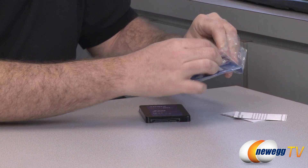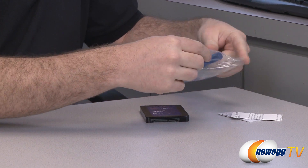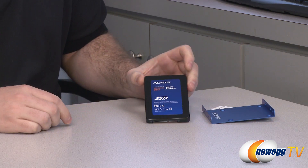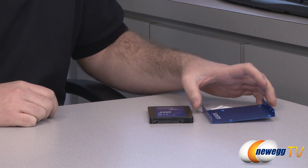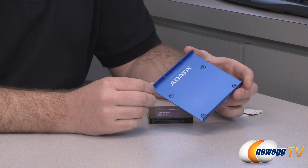Make sure you set your Serial ATA controller on your motherboard to AHCI or RAID mode to access all of those higher level functions. Also, it's a low power device as most SSDs are — at idle it will only consume 0.6 watts and while active it will only consume 3 watts. Finally, it is a SandForce controlled drive which uses the SandForce SF2200 controller.